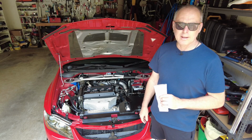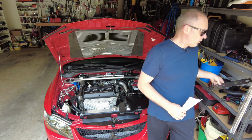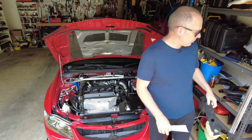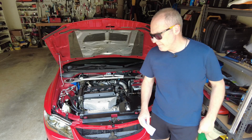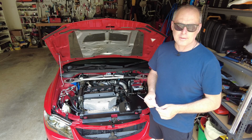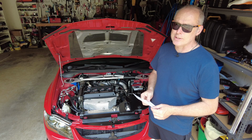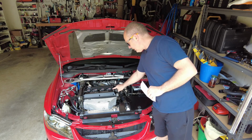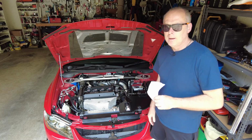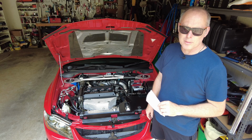It also doesn't need to use a plate for Denso coils. That's the old one of mine. They bolt directly onto the head, so that's quite a clean look. It has the breather ports in place, so that's a big thing for me. It uses two M22 threaded holes, breather holes on the top here with a baffle underneath it. So that is a bit less work if you're running this kind of arrangement with your breathers.